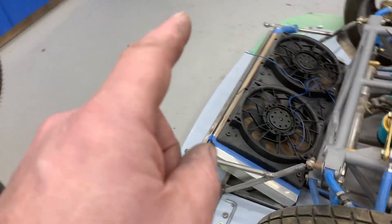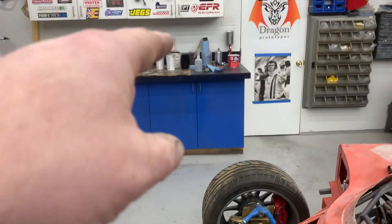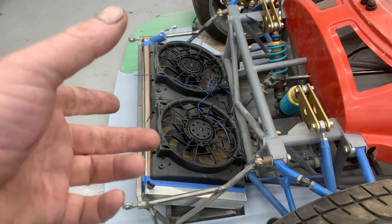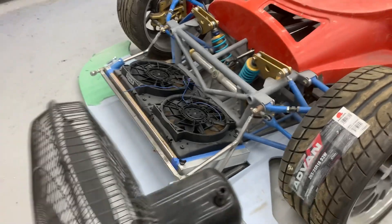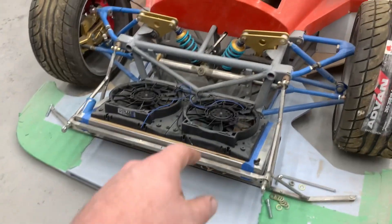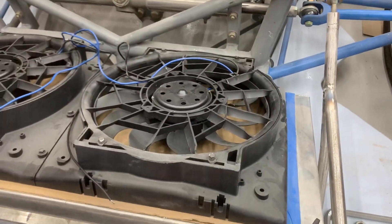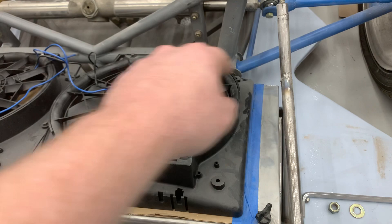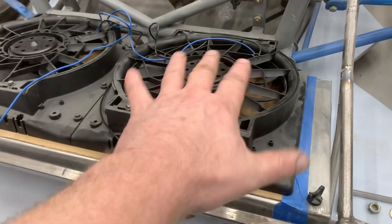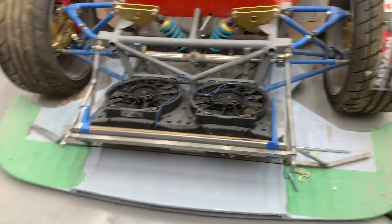I started redrawing the brackets for the front radiator, then realized I definitely need the front clip on first. The original we're molding from is quite thick - when I make the new part it might be thinner and allow me to raise this. Some parts are close to half an inch thick. I'm going to wait until the front clip is on before finalizing the mounting bracket positions. Generally on these, as long as you're rubber-mounted at one end - basically bolt a plate here and put soft foam out the back - so we're not taking any twist load on the rad. If one of these gets pushed up in a corner it shouldn't damage the radiator.